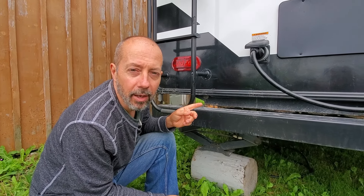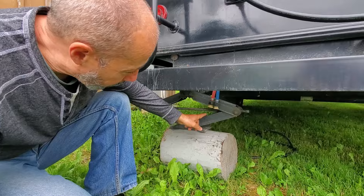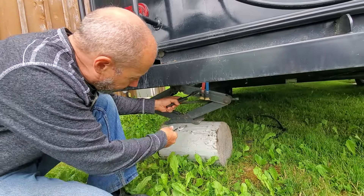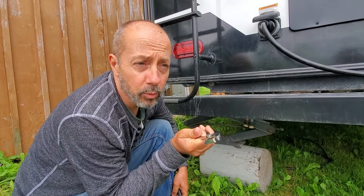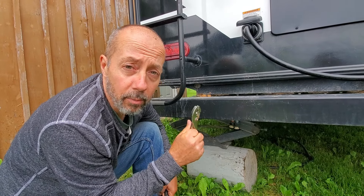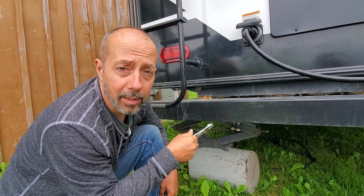It's been about a week and we heard that dreaded sound of the water pump cycling on every few minutes — a sign there's a small water leak somewhere. Luckily it's outside. Walking by, I noticed our low point drain on the hot water side is dripping. Thank goodness, because that's easy to fix — just grab a couple pairs of pliers, turn it back tight, and it's solved. I don't normally put Teflon tape on that connection, but I should, and next time we winterize I'll remember to do that so there's less chance it drips again.